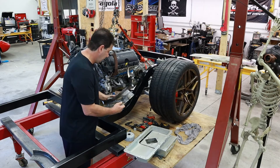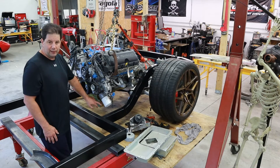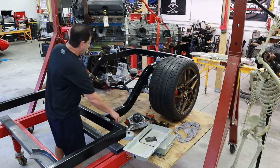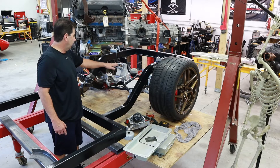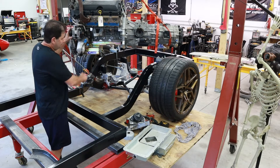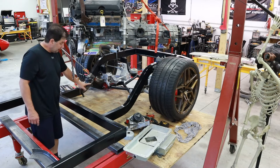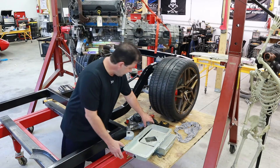The problem I've got now is I really want to tie these two motor mounts together — the front of the right and left side. Let me lift the motor up here. Here's what the problem is: this is actually a second oil pan I've had on this motor. The first oil pan was mounted in the rear, a large thing, set very low, and held like 12 quarts — it was from Ford Racing. I opted to put this oil pan in because when you put it in the back here it hit these rails that used to exist, but I cut those rails up so I don't have that problem anymore. I really want to be able to tie the motor mount from here to here, but obviously this is going to be in the way, so I'm going to put in oil pan number three.